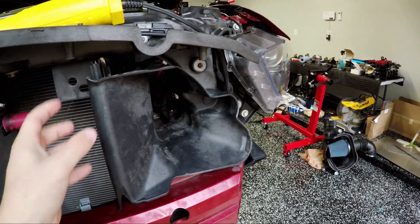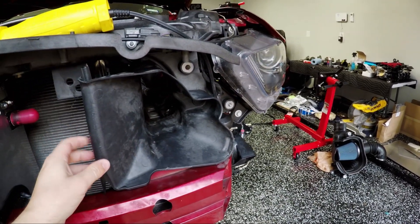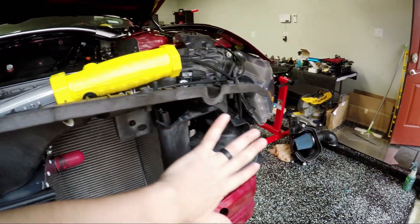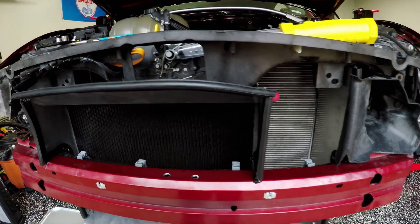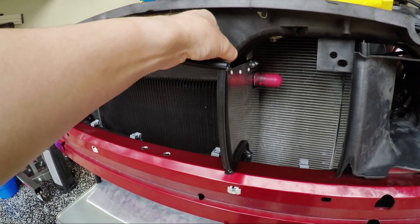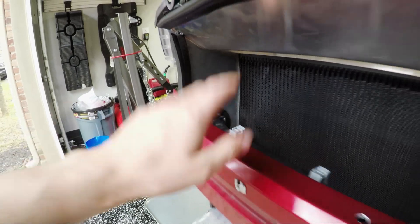This is the mouth for the intake. I wanted to make sure to retain this because the shape is molded to the front fascia there, and it provides a nice little edge to keep myself aware of where I need to cut this so the front fascia fits. There's a good chance I'll need to trim it up when it comes time to fit the front fascia, but I'm waiting to do that until I'm ready to stick everything on. This material here is used to seal trunks — it's meant for covering the ends of sheet metal and creating a seal. I'm using it less for a seal and more just to keep sharp edges from digging into the plastic and wearing things down.